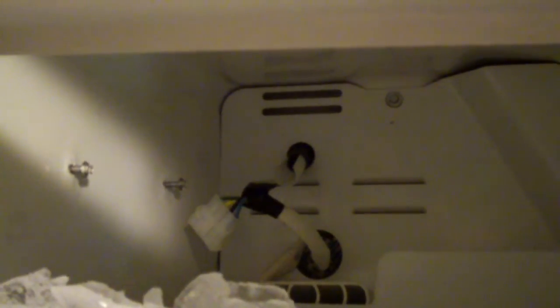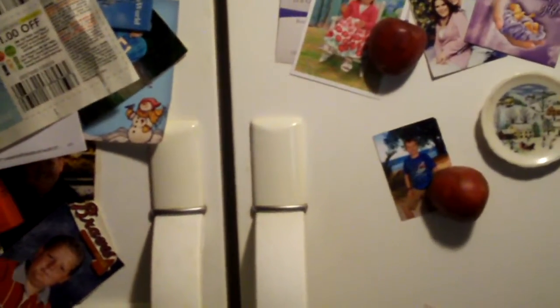Anyways, you can see up inside the freezer here the two screws where the ice maker hangs, and you can see the power plug back there. All that bolts up just fine. Plug fits up just fine, but you see the drain tube, you see the fill tube back there? It is too short to reach this aftermarket ice maker. That's why this aftermarket replacement does not work, even though the seller claims it's an OEM product. Let me explain why the fill tube on the refrigerator is too short for this new ice maker. I'm going to snap the covers back on both of these.